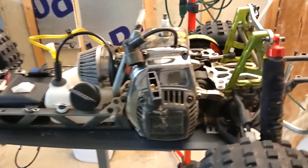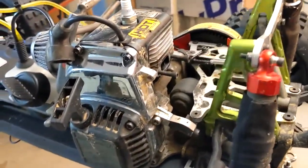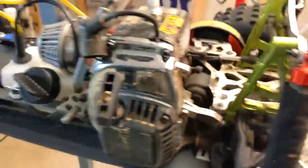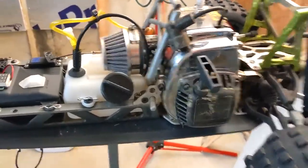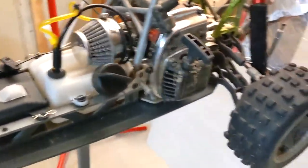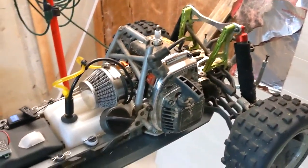Zooming in so you can really see it - no scarring. It's a little dry on the inside. The fuel mixture I was using for the two-stroke oil mix - I think I was running 70 to 1. You can see it won't hurt it, but I'm probably gonna go back to something like 50 to 1 or 40 to 1. I feel like it's better maintenance on the engine long-term. It's a fantastic truck and I want to take care of it.